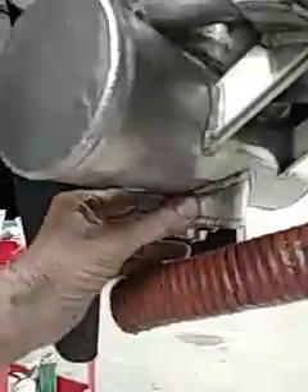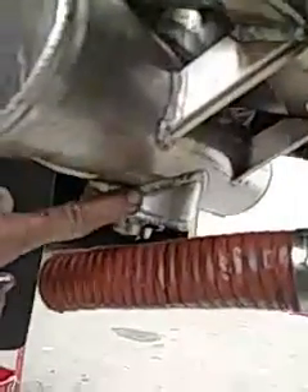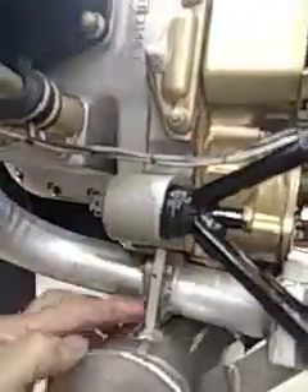There is oil on the scat tubing here — it's coming from somewhere. Look at all this oil here. It could be a leak in this tank there. My welder Chad is like a wizard with that aluminum — can't imagine that's leaking, but something's putting oil out. It could be coming out of that gasket right there too. The intake tubes look good — the thing doesn't show any sign of leaks around there at all.